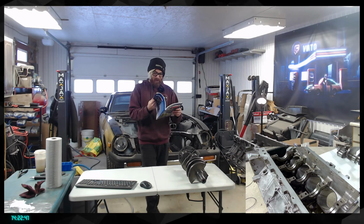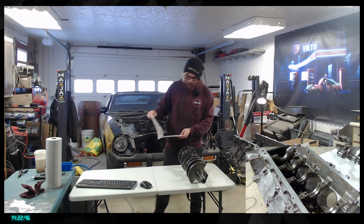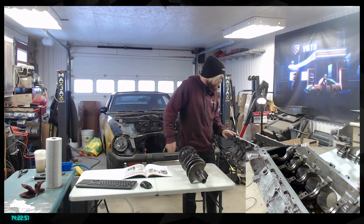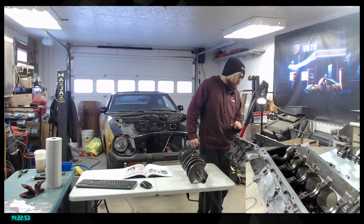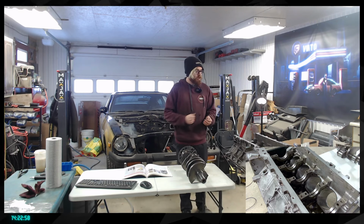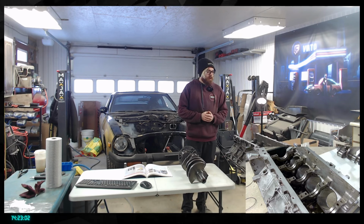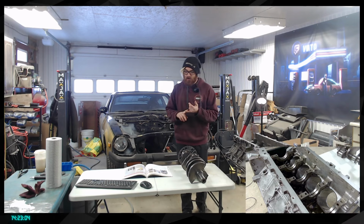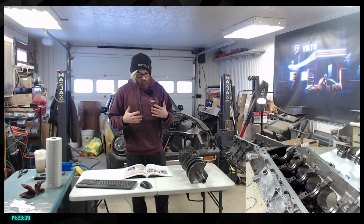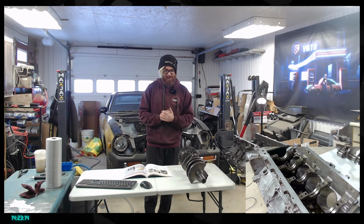So that being said, I will say we are in a pretty good moment right now. I just filled the air compressor, because we're going to spray some air here and there to push any debris out. Since everything's open at the moment, we're going to try to push out any debris, any sand, any dirt that could be stuck inside the engine, in the oil gallery, and inside the water galleries too. This way we should end up with something pretty clean and ready to assemble.